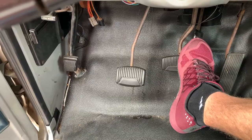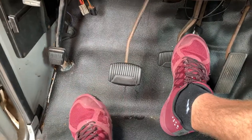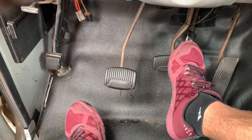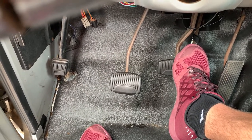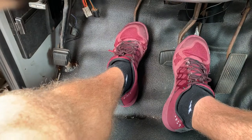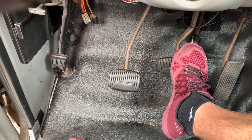I've got my foot on the brake pedal; on the left is the clutch. Watch what happens when I depress the clutch pedal and let it come all the way back up. In the final inch of it coming back up, you'll see it slow and kind of not stay up with my foot, and then suddenly clunk back into place. You can see that clunking — it's like a catch.